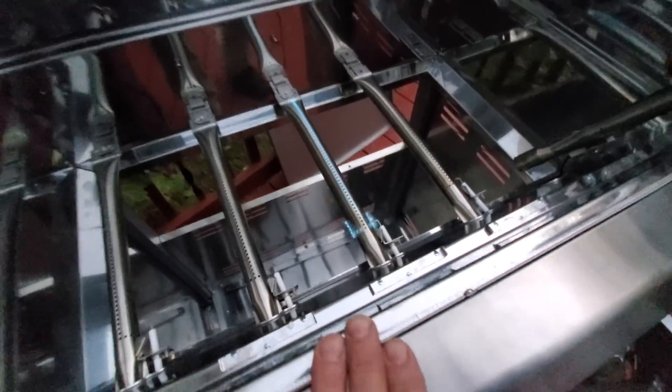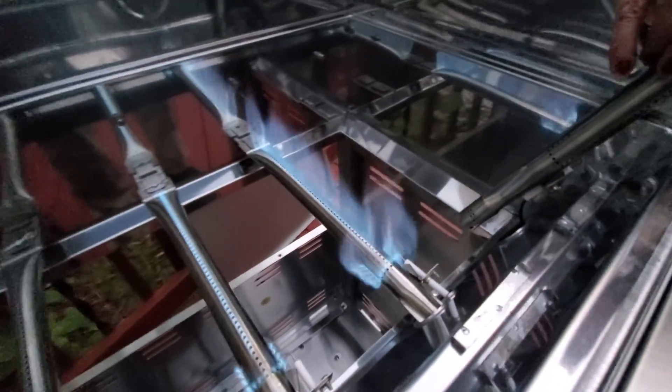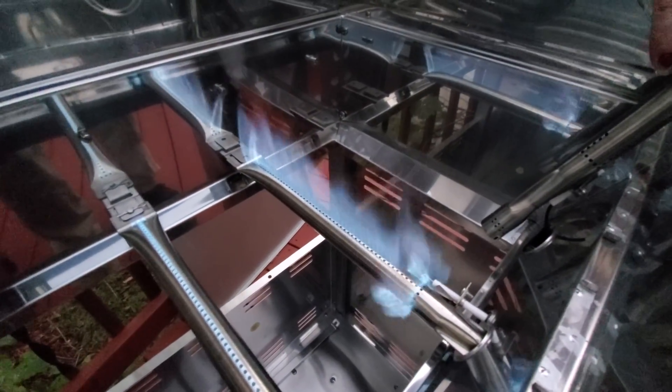You can only drill it bigger if you're going from propane to natural gas. This was bought as a propane grill and I converted it to natural gas. I just wanted to share that because it worked so well. Disclaimer: I'm not telling you to do it this way — make sure you check the chart and test it before you use it.